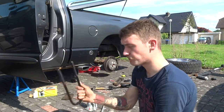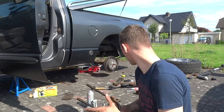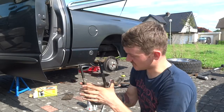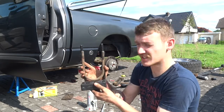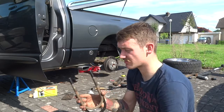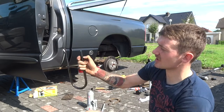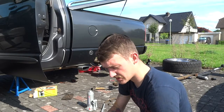So when you install it back together again, you're going to use Rough Country's extended U-bolts. It comes with washers and nuts — I was keeping mine spare just in case, but it turns out they actually come with them. You'll notice there's a substantial difference in the length of them. And even with the lift block on, there's still quite a lot of protruding thread. So what this means is a little bit annoying — you're not going to be able to torque them properly. You're just going to be able to do them up really, really tight, unless you trim them. You're probably going to be cutting them off around halfway up anyway.